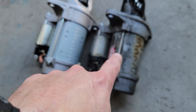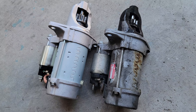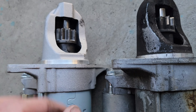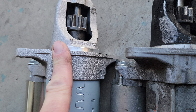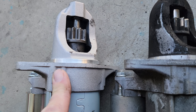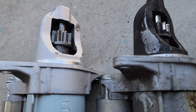Here's the old one — this one was not completely dead, but we'll keep it in the event the new one fails. This is probably about a 35 to 40 minute job. Because Subaru is very specific about manual and automatic, you need to make sure the housings are the same size and count the teeth. This is a nine-tooth. Locally this starter was about $230, the cheapest was about $189, and this one was about $80 on Amazon — and I don't really see any difference from OEM. If you have a local shop that can rebuild your original starter, that is also an option.